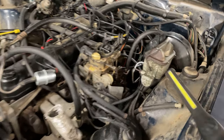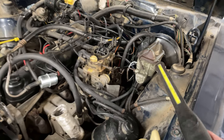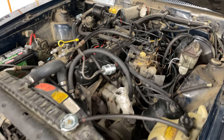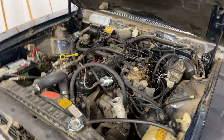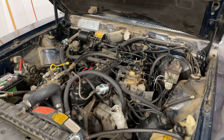So that's kind of what I've been up to — just replacing those vacuum hoses and trying to get the thing running right in time for winter. I'm going to replace the master cylinder since the seals aren't perfect inside and the pedal feel isn't 100%. The only other thing that's really pressing is I want to rebuild the carburetor — it doesn't run super awesome in winter — so that will be coming up real soon.